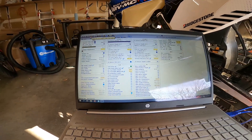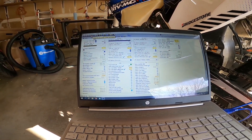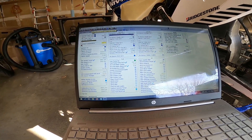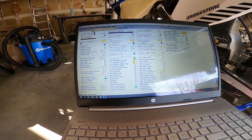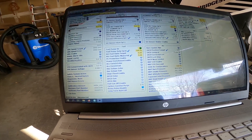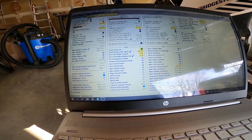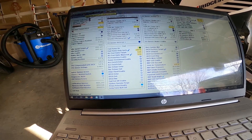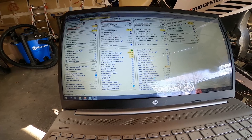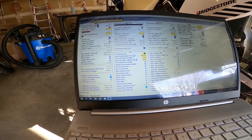Here's where I stopped cranking — my voltage went back up to 12.5. Here is the next crank. On the next crank I'm at 5.34 for the AFR — quite a bit higher, definitely higher. My IAC went back to 120, which is the default.